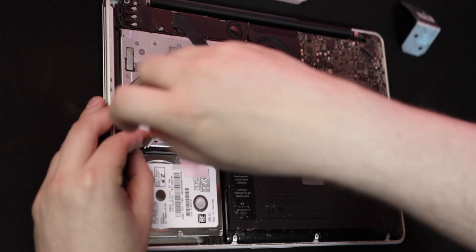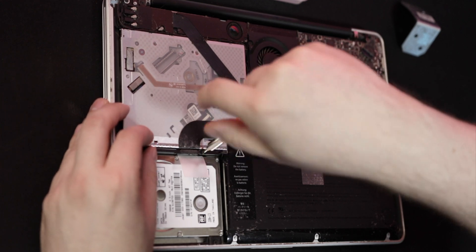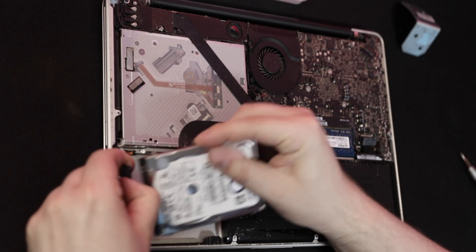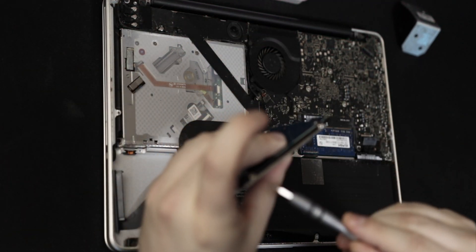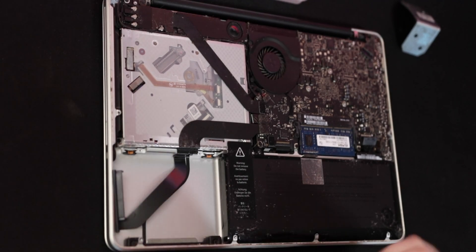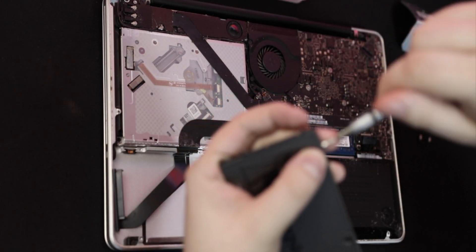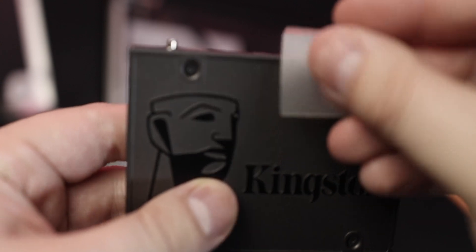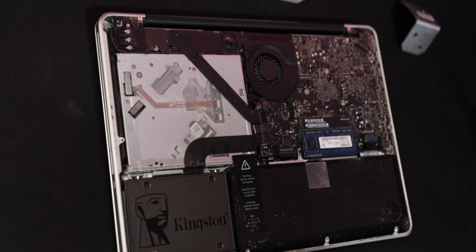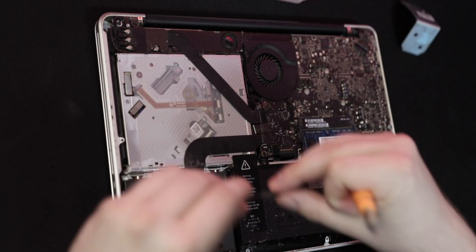I'm going to use the Phillips head screwdriver to take off this little hard drive bracket — this just holds the hard drive into the cradle here. Now we can unplug this ancient mechanical hard drive. I'm pointing to the four Torx 6 screws that are in the sides of the hard drive, so we're going to take those out and put them into the new SSD. Using my Torx 6 driver to put all those screws in the sides — it's necessary because that's how the hard drive sits back in the cradle. You probably could do it with a flathead screwdriver, but I strongly recommend you use an actual Torx 6 T6 screw bit. Now we're seating that baby back in there and putting that bracket right back on.